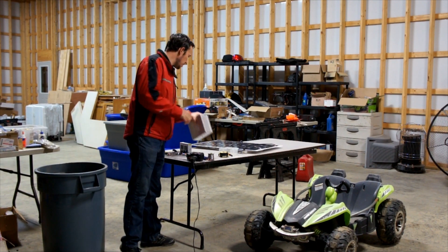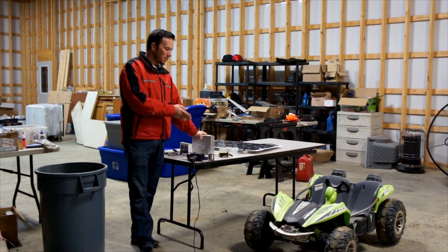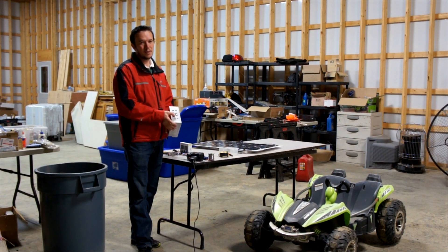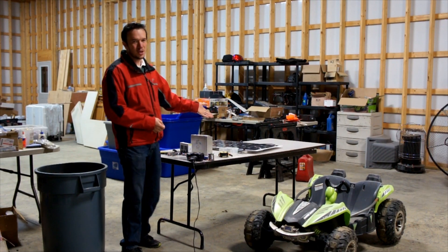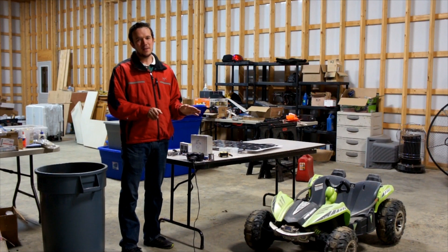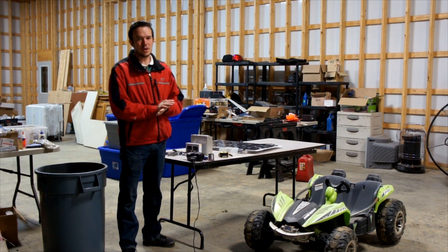So we're going to put this battery in there and get the 60 watt panel. The kids are getting a fairly short run time with this lead acid battery. With the new battery, I'm going to get around 2 hours run time in this car, and it's going to take 4 hours to charge up again with the 60 watt panel. That should be a really good balance. And we've got a charge controller, so let's get started.